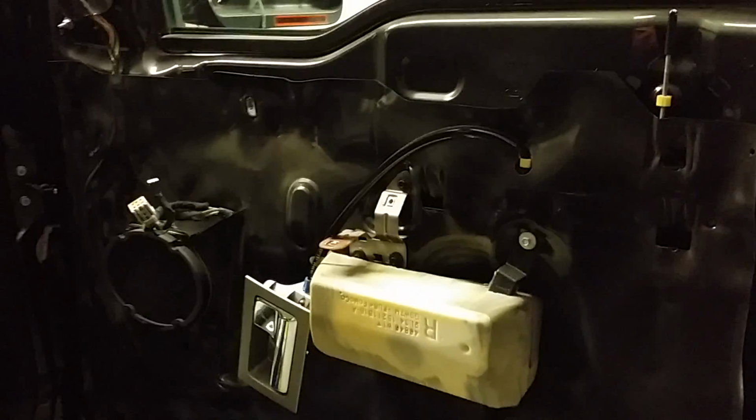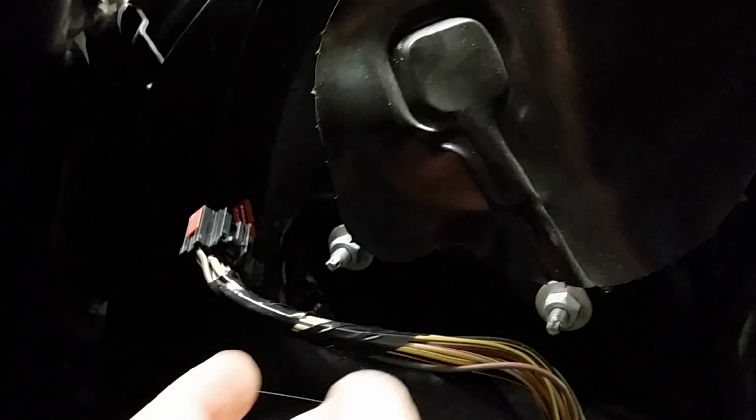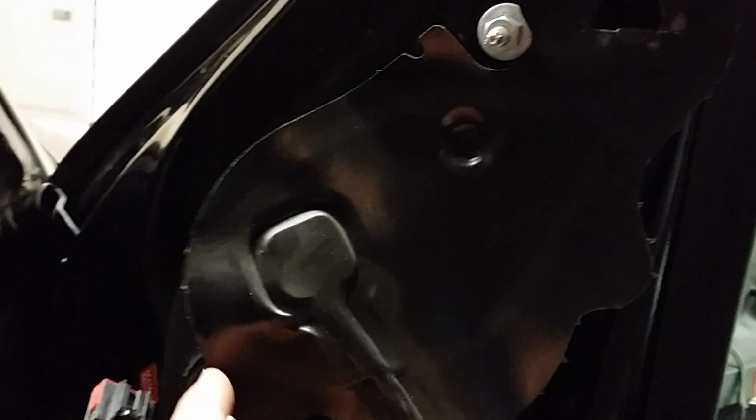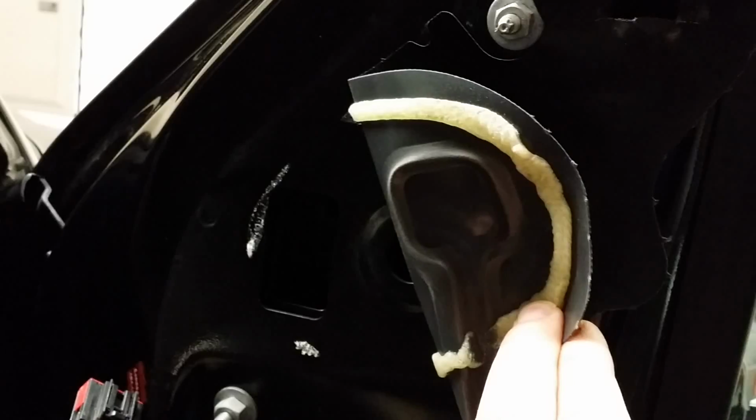Now that the door panel has been successfully removed, the next step is to gently pull back the protective coating and disconnect the wire harness from your exterior mirror. After you have successfully uninstalled the motor power clip, the next step is to remove the 3 mirror housing bolts. This will allow the removal of the mirror and the running of the power cable.